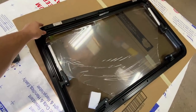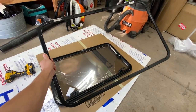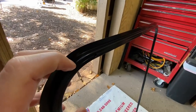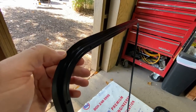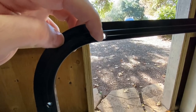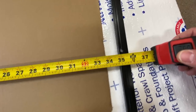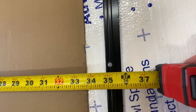We've removed the inner trim ring from the window and now it's time to cut out our cardboard template. We're going to use the inner trim ring to trace it out. The line we want to trace is where the two pieces connect on the inner window trim — the outside line on the inner flange. Don't trace the inner line; trace the outer one. You have bolt holes, and just outside the bolt holes is the line you want to trace. A tape measure from outside one bolt hole to the other shows just under 35 and a half inches.